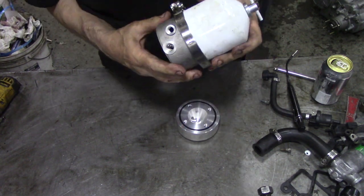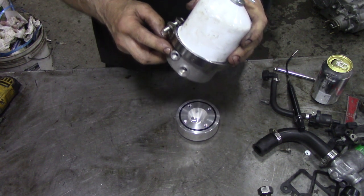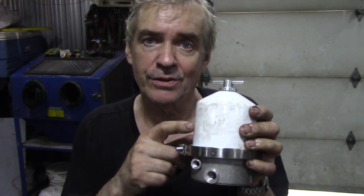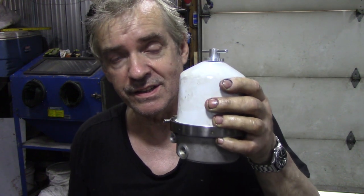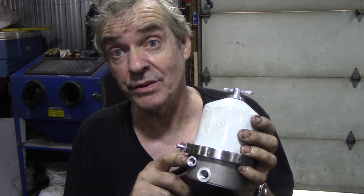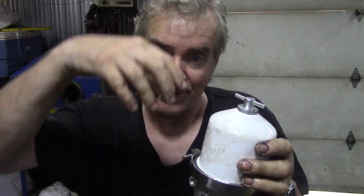You're going to ask why there's a second hole here — it puzzled me for quite a long time. In some of these setups they sell a little electric compressor, only 3 psi, but it's enough to pressurise the container to force oil back into your engine. This was originally a device to sit on top of your engine, with a tapped inlet from an outlet on your block. It spins and cleans all the carbon out, then pushes it back — the 3 psi port is there because once oil has gone through the centrifuge it loses pressure and can back up. But we're not going to use anything like that, probably.